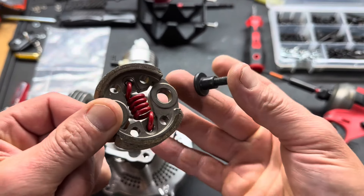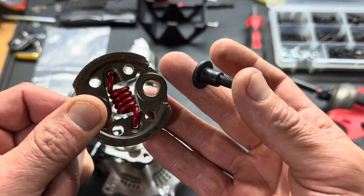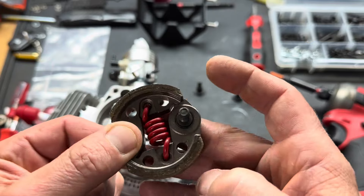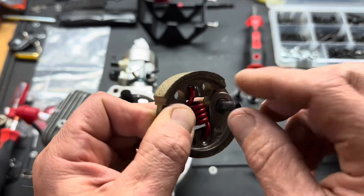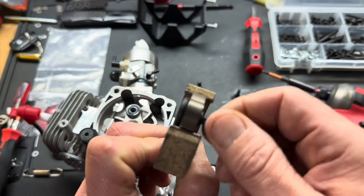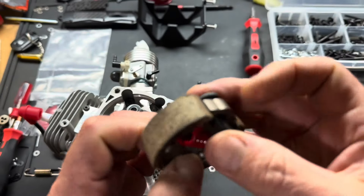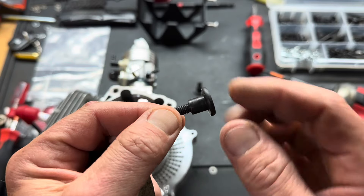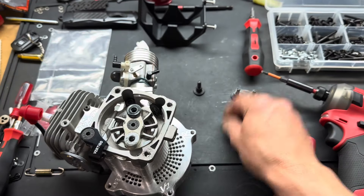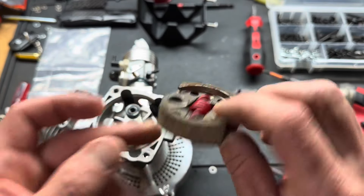So how do we fix it? We fix it with these right here. You got to use Chung Yang bolts with a Chung Yang clutch - tight and right. Also when you put these in there you want to check them, make sure that they spin free with no drag. Those feel pretty good. If you do have drag, I got a video on how to clearance these in my little drill lathe. We're just gonna plop that on there and get her tightened right.